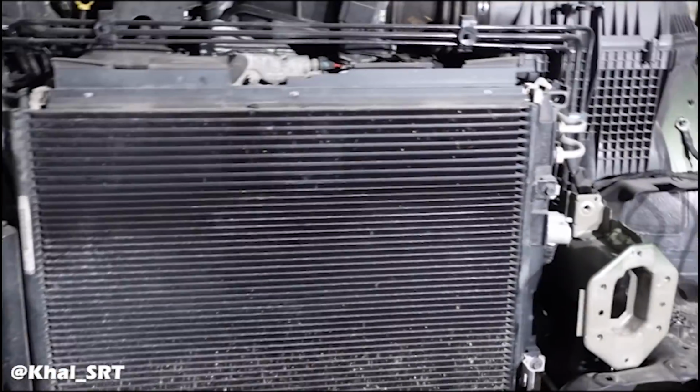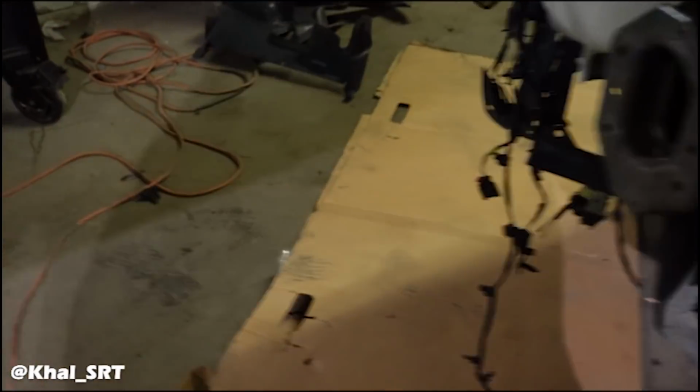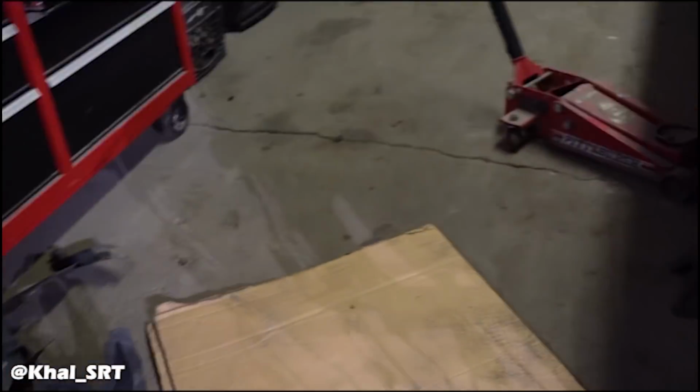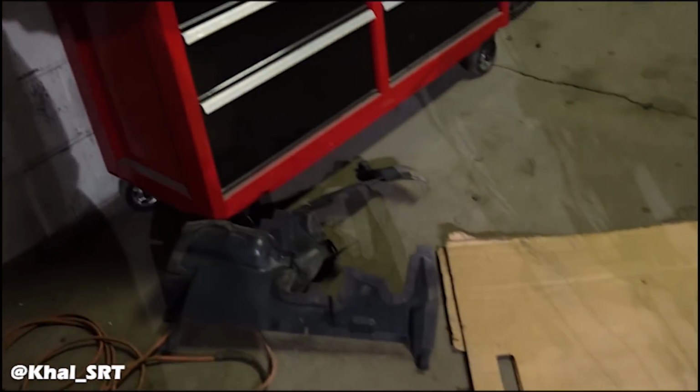Support off, I got the rebar off, I took all the airbag sensors off so they will stay with the core support. Now I'm going to drain the cooling system, and I'm going to show you how to do that. There's a bleeder valve right over there. Just get a pair of pliers and gently twist it counterclockwise, and it should loosen up, and then I'm going to drain it all in this bucket. Because it's a weekend, dealerships are closed, and I have to refill it to get this car out of here. So I'll go ahead and do that and wait for it to drain.